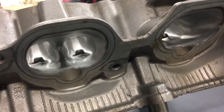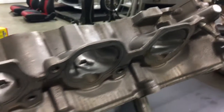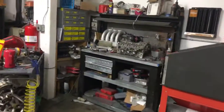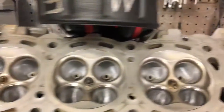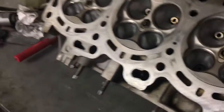There's a finished port job on one of our two cylinder heads. We'll take a quick walk over here — got a couple of things going on in the fab room. We've got another cylinder head getting close to done. You can see we haven't got the chambers polished, but the rough out on the intakes is coming along nicely and the exhaust is as well.